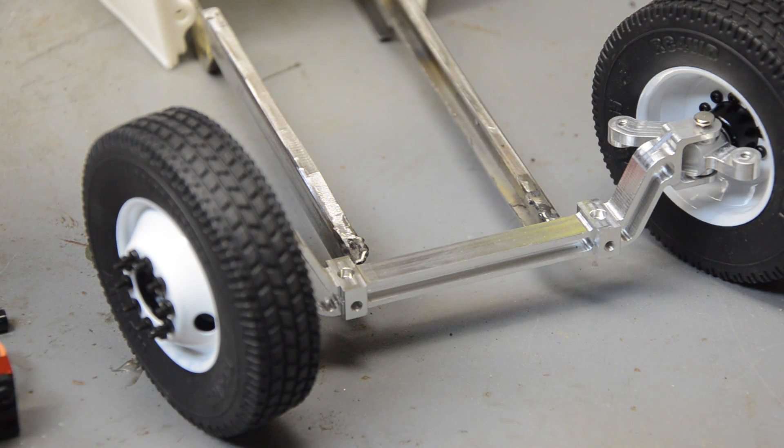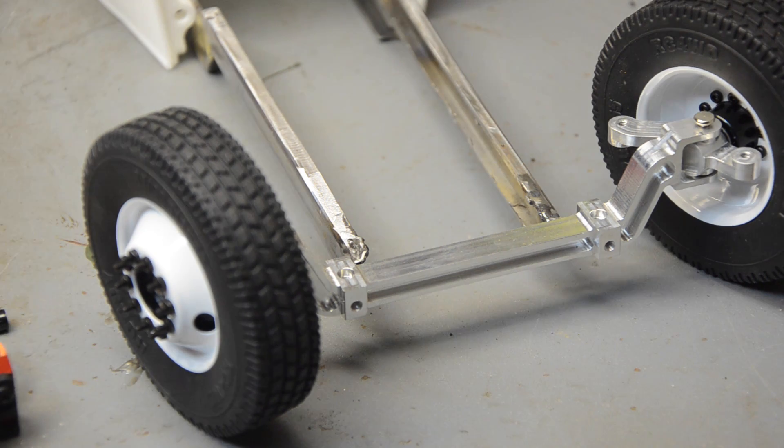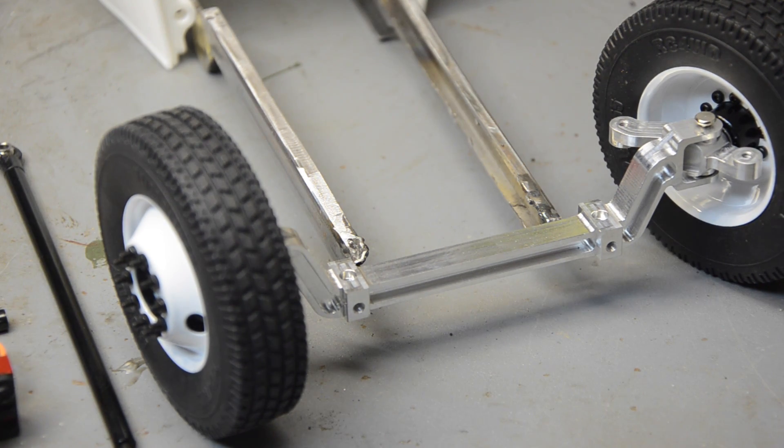They will hinge on the chassis back towards the firewall with a standard rod end, and just like on my '32 Roadster they will act like a torsion bar, eliminating the need for a panhard or a full 4-link or 3-link. You just have those 2 links and it still allows flex side to side and travel up and down. A lot of early 2000s 4x4 SUVs have a torsion bar front end — no spring up there, just the bar and a shock. It's not great for off-road performance, but in this situation it gives us more stability and it worked out well on the '32.